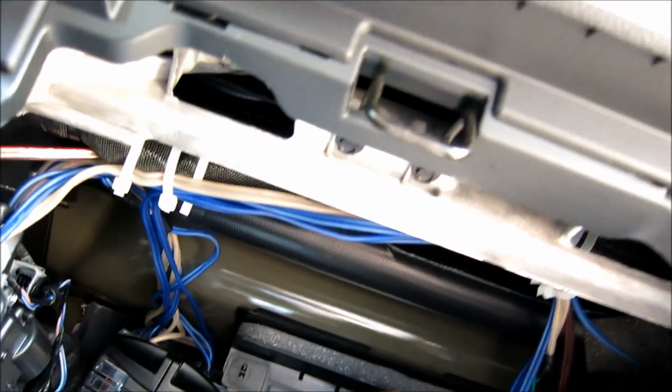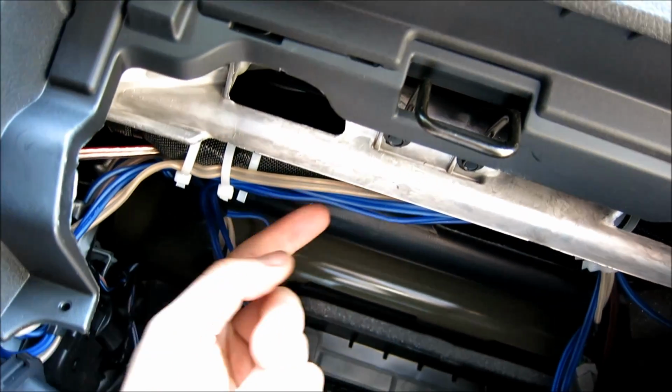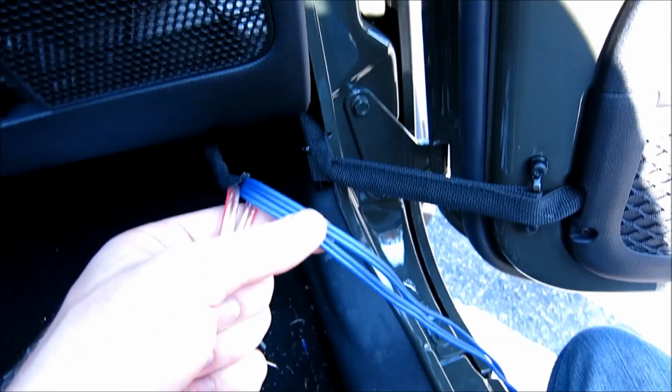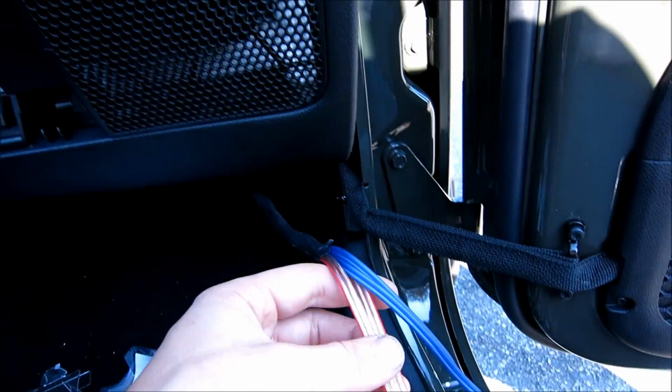These right here are the lines that are going. So as I told you, tweeter and woofer go here, and then an input wire comes out. So the wire is coming out and down through here. And I've taped the 2 wires going to the line out converter right here, and the 2 wires going to the amplifier right here. Both blues are the crossovers, and these 2 right here are the actual speaker lines coming from the stereo, which I stole from each of the speakers.